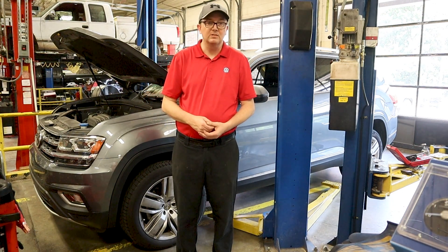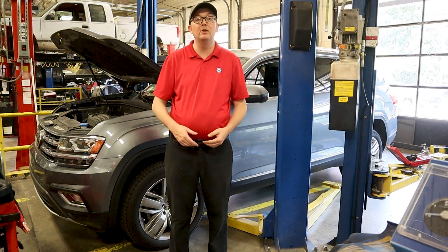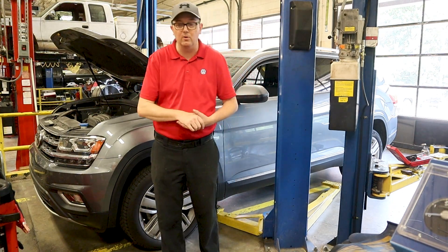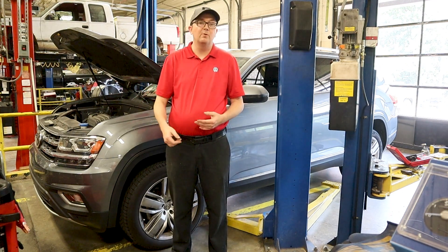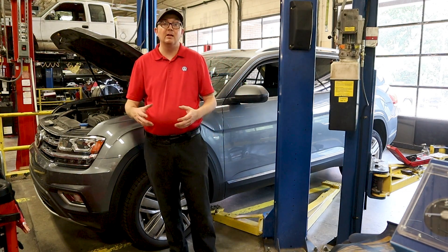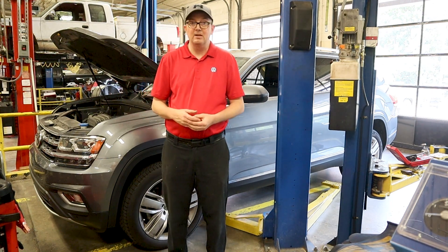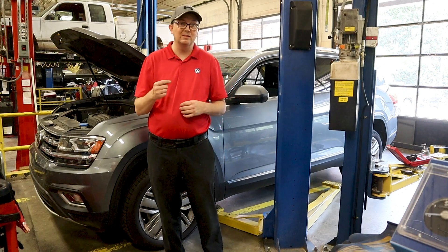This is a common procedure if you've ever done brakes before. After you do that, check the brake fluid — make sure the brake fluid condition and everything is good. I do have videos on brake fluid condition that I'll link up and in the description. Then drive for a couple of miles slowly and drag your brakes from time to time so the brake pad can bed in and seat against the rotor. If you hear any noises, you may want to take it apart and check that the backing plate for the rotor is not rubbing, or that no piece of hardware is out of place.